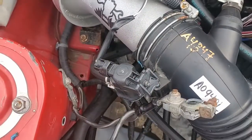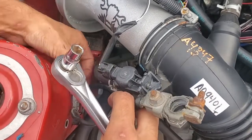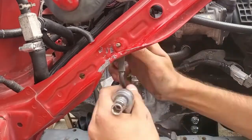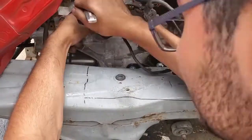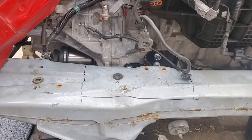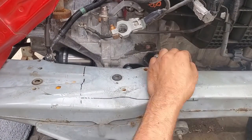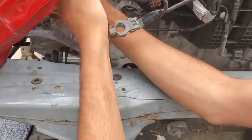You can use the stock spider battery, but anything bigger might not fit behind the muffler. The starter wire just bolts onto the terminal with the chassis fuse box wire going to positive and the transmission wire going to negative. The transmission wire is reused and can be bolted to any hole in the transmission — just make sure it's clean and making good contact. I moved the chassis ground wire to a small thread on the X-frame, also making sure it was sanded clean. If you are going to reuse the muffler, you need a thicker heat shield so that the battery doesn't melt. My heat shield was touching the battery but because it was double-layered, the other side barely even got warm.